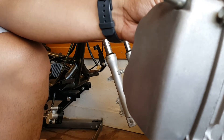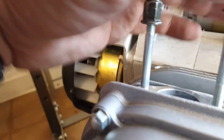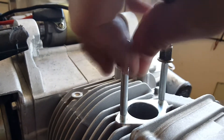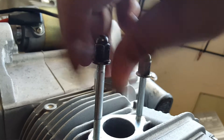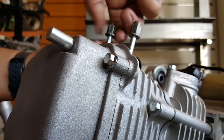So we're going to put these in. Most people usually when they get to this point, they upgrade this usually to like maybe a 28 to a 30 — 30mm intake manifold size for the carburetor. Usually people upgrade to a bigger, higher performance since this valve here is a little bigger than the stock ones, so everything is pretty much in proportion. So we got that tightened down. Now we can go ahead and unscrew this here. Normally it's not that easy, especially when you're holding the camera.